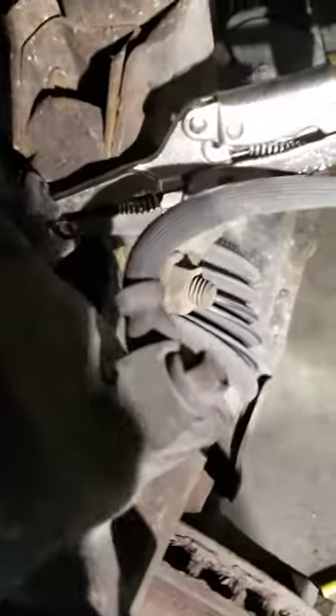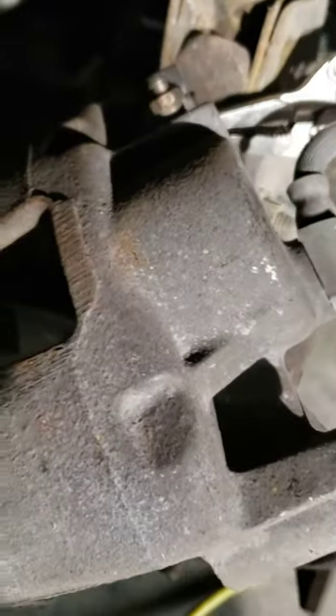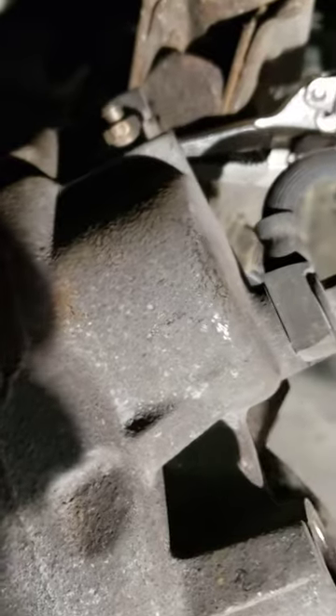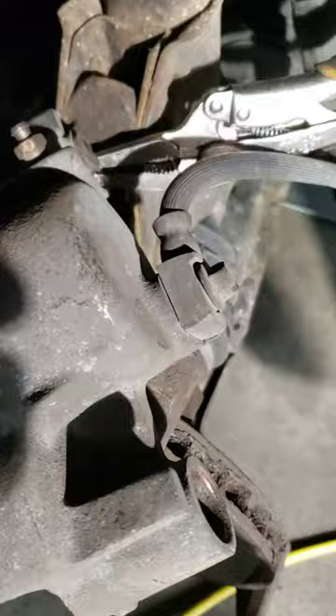So, I bought all new rubbers that the slide pins go into. What I did is I grabbed my vice grips, I pinch a part of it, and I twist it until it pops free from the back and goes towards the brake pad side. It's sort of a pain, but that's usually how it goes when doing the right thing.